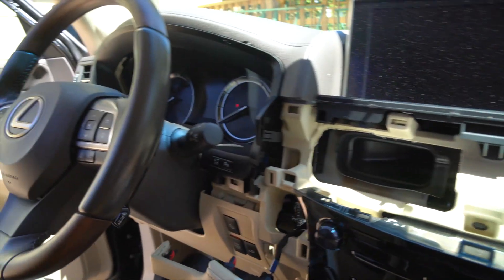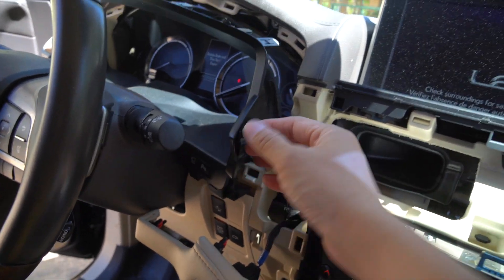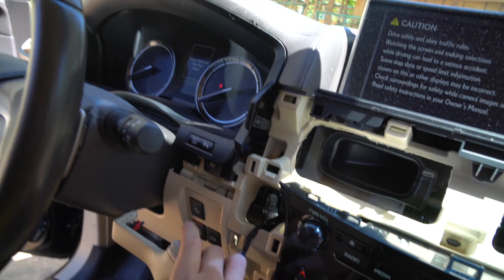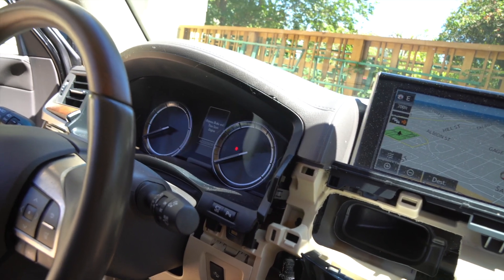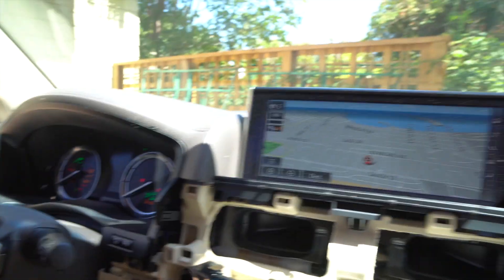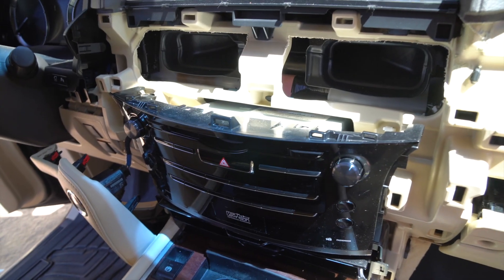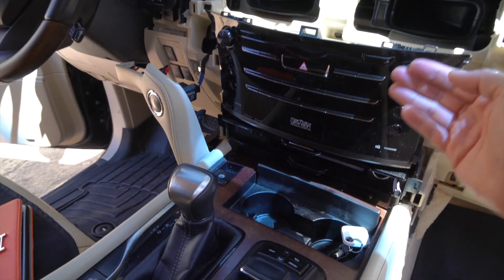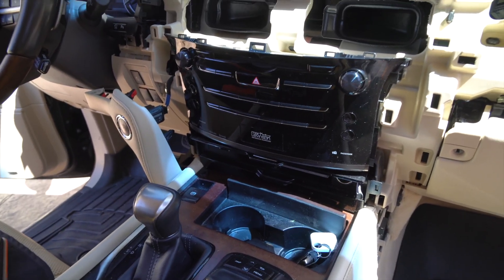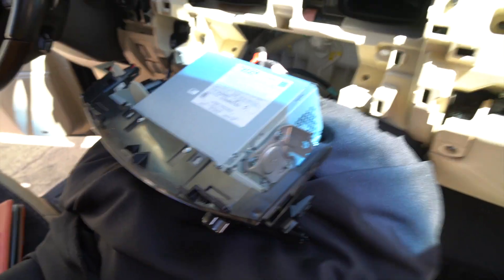Before we were able to pull the whole piece out, we had to turn on the car for a moment to pull the steering wheel out — that gives you a little bit more room over here. Don't force it; if things get stuck don't pull it out. Know where the resistance is and make sure you get that area taken care of. Next, all we have to do is remove these two 10mm bolts — one right here and another one right there. After those are removed, this is ready to come out. Make sure you lay a thick blanket out here so you can place it safely without scratching anything. We removed the two 10mm bolts and pulled the radio out, placing it on a big piece of towel.